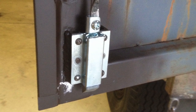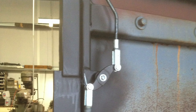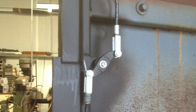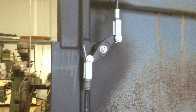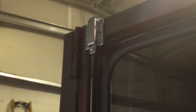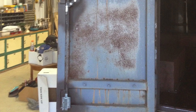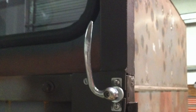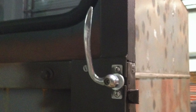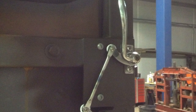I put in the latch hardware that you would normally find in a 40s truck. Originally this truck was just a prop, and so it had gate hardware that would allow you to close the doors — you can actually see one of the latches there that I went ahead and left in. But this truck received a full working latch mechanism so it worked off of the back handle on both doors, operating very smoothly, just like it would have if it were built in the 40s. This is the primary door, which you open first, and I made an interior handle mechanism work for that so you can get out from the inside as well.